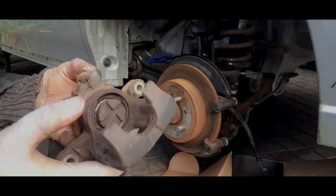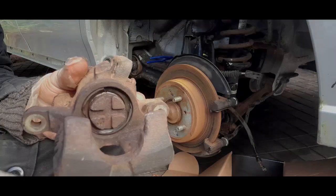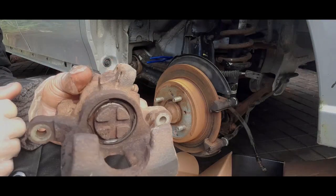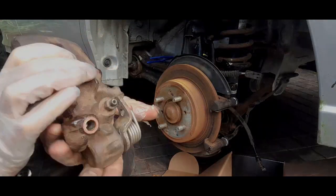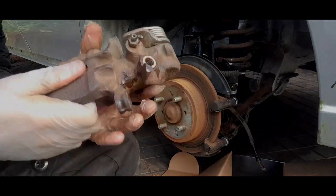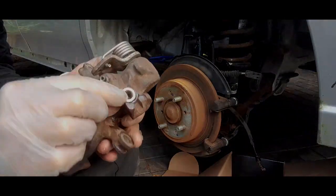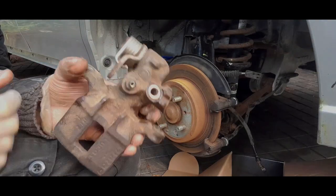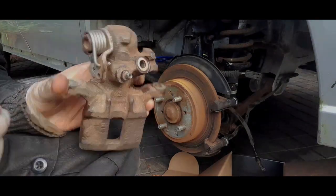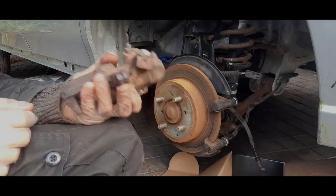You can see how bad the seal has actually gone - the piston was seized pretty much and the seal has just gone completely. It's absolutely useless. These Lucas rear calipers have always been known to do this. Look at that - the copper washer has actually been crushed in. And that bleed nipple - no chance, not without a bit of heat. Right, in the bin.